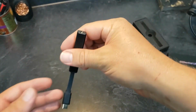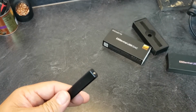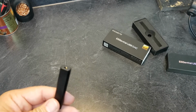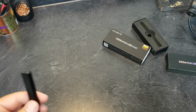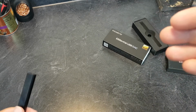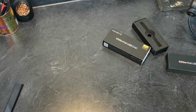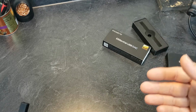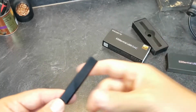So depending on what I'm doing, in the little Windows speaker icon, you can just click, and Windows 10 allows hot swapping of audio devices, so you can change it anytime, and it should switch over. You don't have to close the program and reopen it. You can pretty much do it on the fly. If you're an avid user of Windows, a lot of times you couldn't do this in past versions. If you changed the audio device, you'd have to close whatever you're doing and reopen it, sometimes even restart the computer. Windows 10, you don't have to do that.